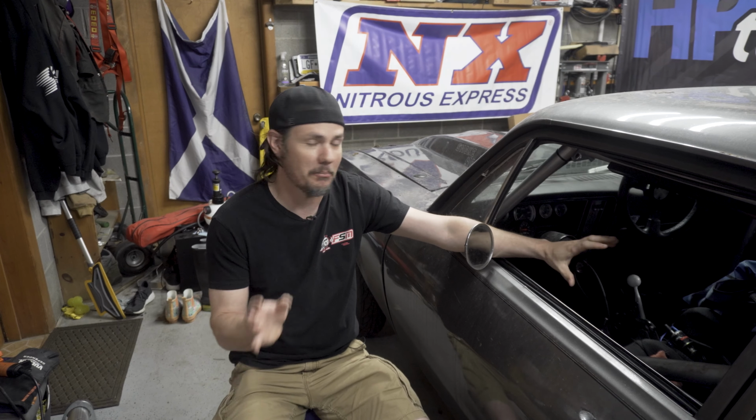It was undersized. And what ended up happening, to even make it from Great Bend to Pueblo, we had to run a generator hooked up to a battery charger, roadkill style, to add the additional 10 amps, not like the medium setting on the battery charger, to even get this thing to go down the highway. Soon as that thing would turn off, the alternator would load up and it would throw another belt.